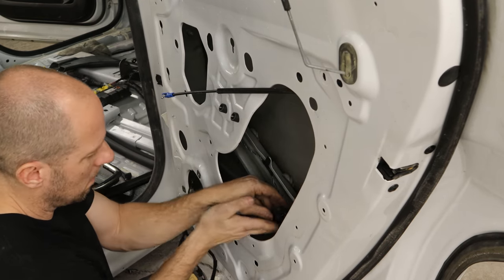That's why there's paper down there — if you spill the foam or get it on the carpeting, it's not easy to clean up. It actually doesn't clean up. While we wait for that to fully cure, we'll plug the seatbelt in on the driver's side end and bolt the bottom of it in. Put our little plastic clips in there, route the seatbelt up the pillar — there's one little metal clamp in the middle with a pushpin that holds it in. Connect our seatbelt to our adjuster and tighten that up to manufacturer specs.